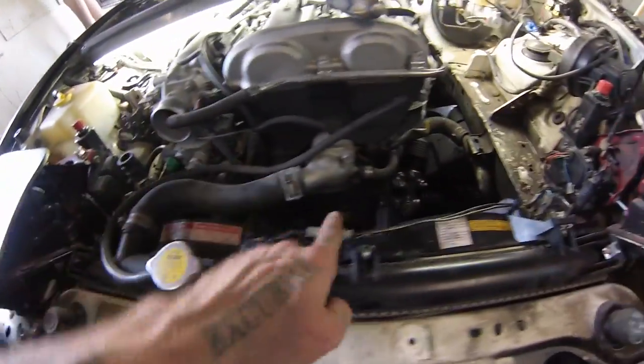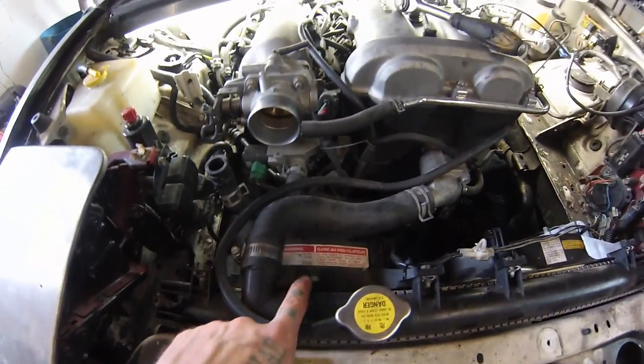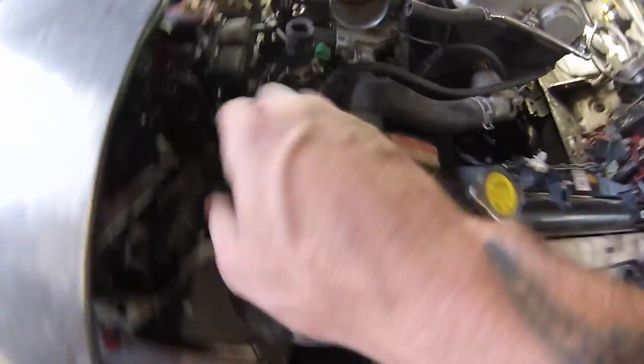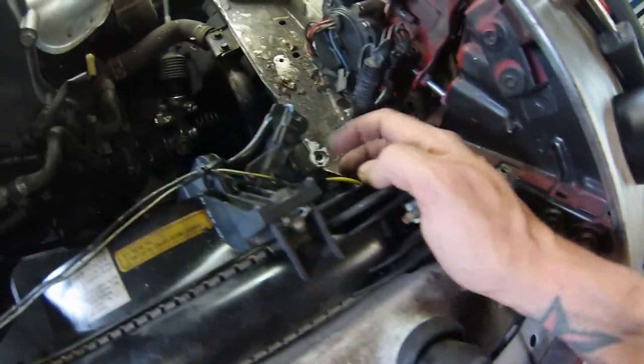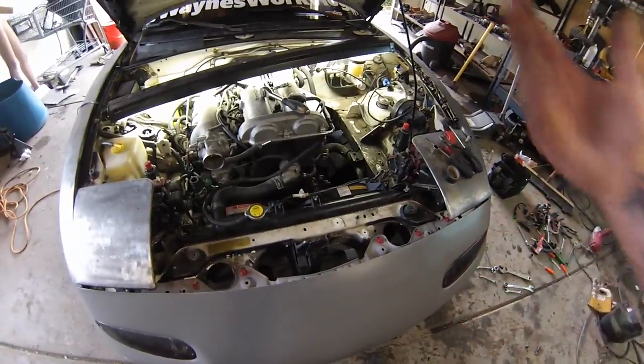While I'm in here buttoning everything up, I cut the wiring that ran over here for the left side fan. Normally this is the AC-only fan, and if you had a non-AC car then you won't have this fan. Clearly only one fan is enough to run the heating and cooling systems, but I went ahead and clipped the wires here and that gave me enough wire to splice in so now when this fan cuts on this fan cuts on as well — I'll have double the cooling. Eventually I may end up wiring a dash toggle switch to turn that on and off independently for lower speeds or drifting, etc.